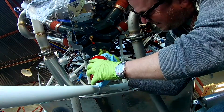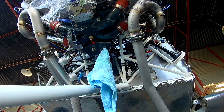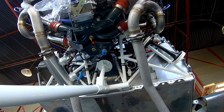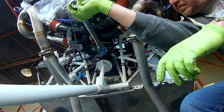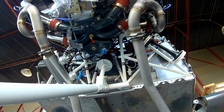Next, now that we know where all the exhaust and everything is, I'd gone and drained all the rest of the preservative oil out and we are putting our quick drain plug in right here. Unfortunately I could only find this one — it uses 5/16 interior vinyl tube. We have all of these on our club planes and they're great, but some of them have a bigger diameter which I wish I'd found. Anyway, it is what it is and now it's safety wired in place.